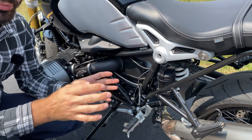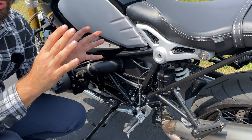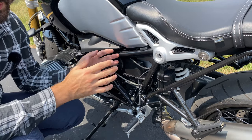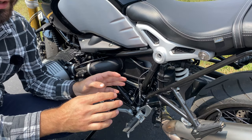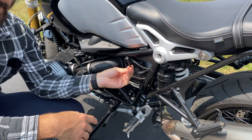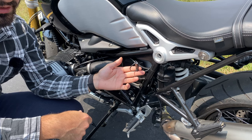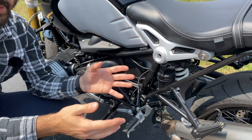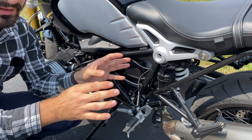This bike has already had a new battery installed after only 800 miles because the previous owner left it over winter for two years. BMW also recommends plugging in the bike if not ridden for more than four weeks. Note: you cannot jump start the bike from this socket — the wires are not rated for high current and can cause a fire. It's also recommended to use only this socket to charge, as the onboard electronics monitor it and know when the battery is fully charged. If you'd like to charge the battery directly, you must first remove it and disconnect it from the bike.